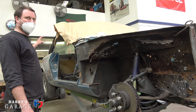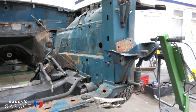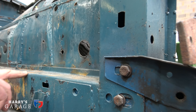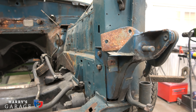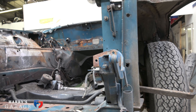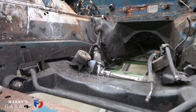Going back to the original video where we pointed out problem areas — it's not until you remove the engine and gearbox, all the engine bay ancillaries, and clean everything up that you see the full picture. There's a key thing here: looking along the chassis leg, there's a weld all the way up here, with a nice shiny blue panel as opposed to the matte blue behind it. The front half of the chassis leg has at some point been cut out and replaced — it would have been quite some time ago as factory panels have been obsolete for years.